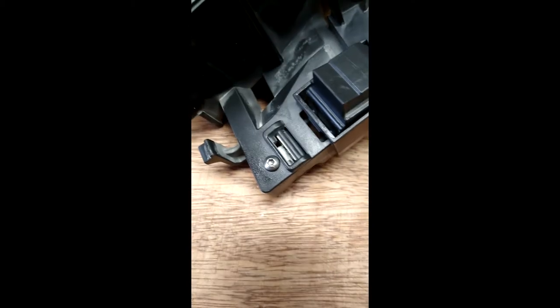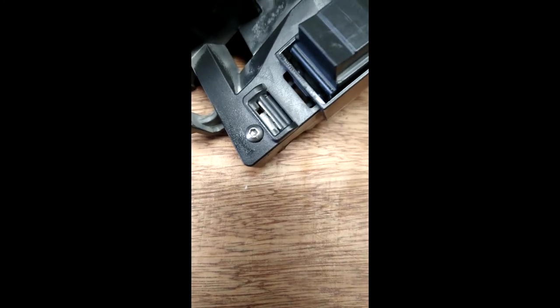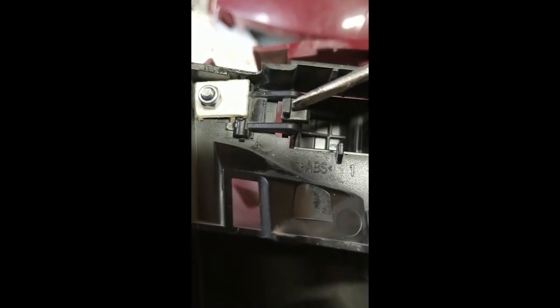Here's the top view of the switch. You can clearly see this round section — that was the bit in the initial part of the video that had fallen down by about five millimeters because it wasn't held in by the two small retaining clips. There's my bolt, and you can just see the white piece of plastic I've installed. When I push this up and down you can see it now rocks nicely — so hopefully we're a winner. The switch reconnected — the switch should just push back down because this little retaining clip here you just push slightly to the left and it allows the switch to drop down, and the other side retains the switch in its position.